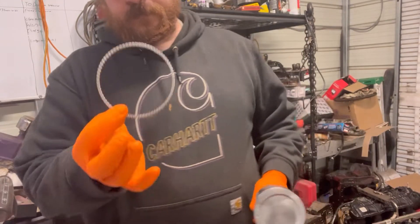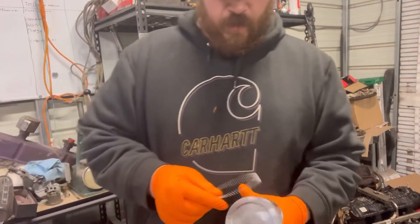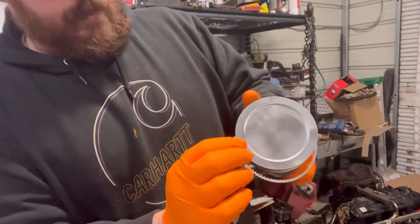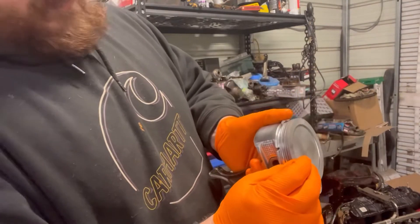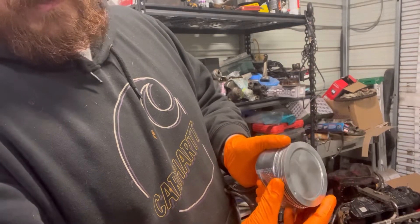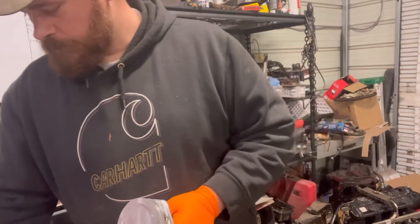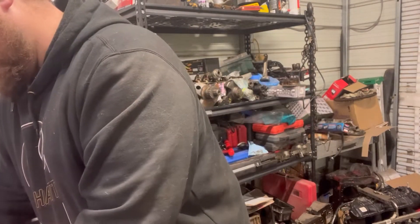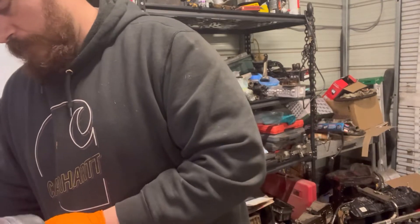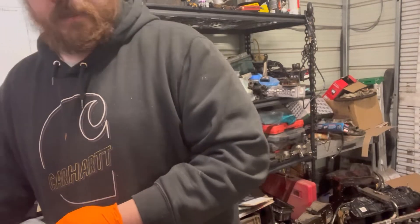So your oil ring is this one — the very bottom oil ring groove. You want to alternate each one of the openings. You slide it on there like this. What I do is I use my thumb to hold one side kind of in there, not a lot of pressure at all, and then stretch it around and put it to the other side just like that. Then I flip the piston over and grab my smaller oil rings — these are the ones that keep that one in place, and they do a slight scraping job to keep the oil regulated like it's supposed to.